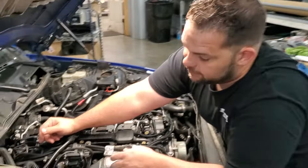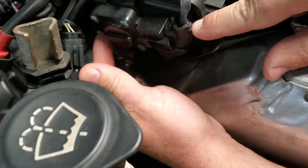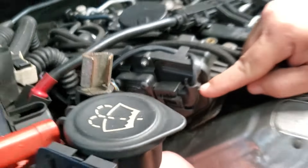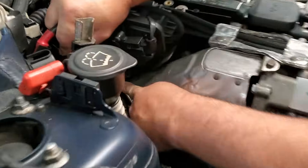If that's okay, then your problem is going to be your exhaust gas manifold pressure sensor — that's this thing right here. This sensor can fail, but it's not common. What's really common is this hose right here. This hose tends to dry rot and break.